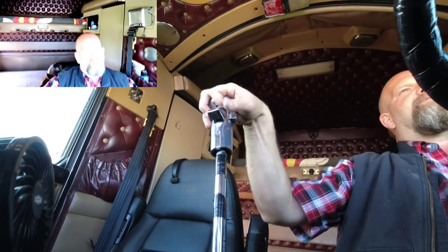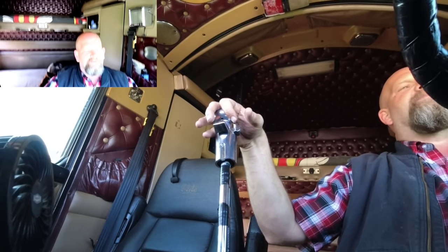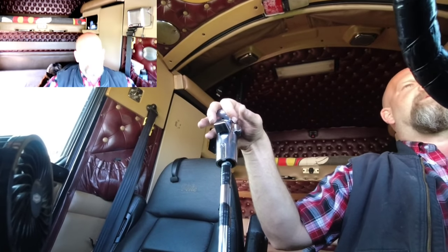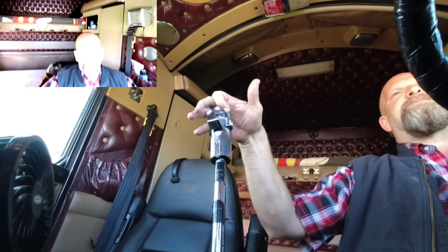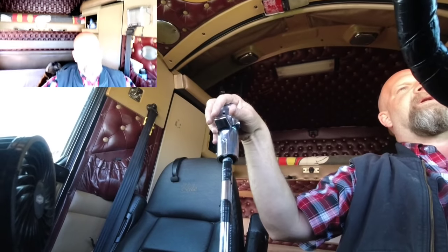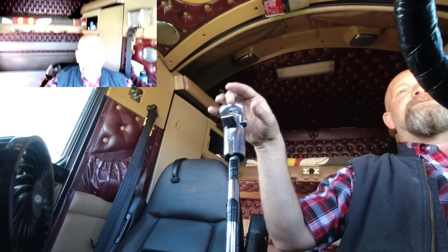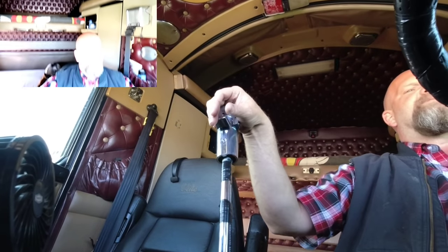As for RPMs, this is a little bit heavier load, so I'm taking the RPMs up to around that 1500 mark. It's usually around 1450 to 1500. Now we're just going to final out. There was 15. You guys were super bright on the side of my face, so I'm sorry about that. But that is 15th gear right there. Now you're wondering, you still have three gears left, right? 18 speed. No, reverse. Remember, reverse has three gears. Here's your 15, 16, 17, 18 in reverse.